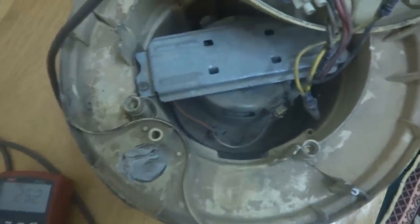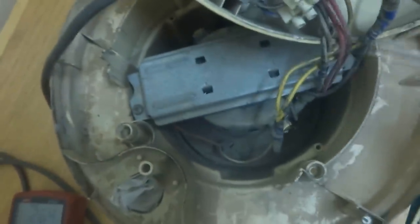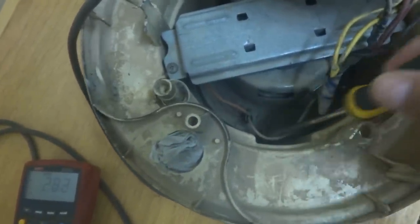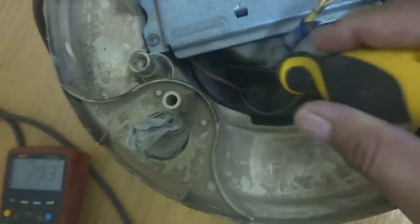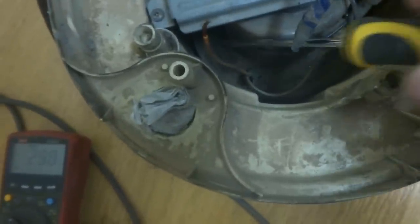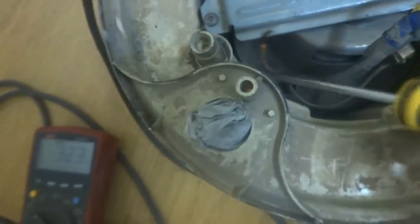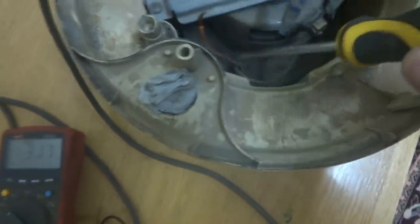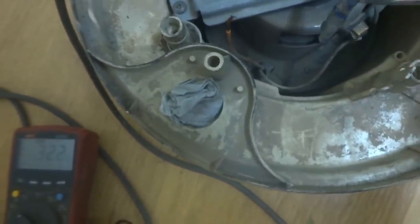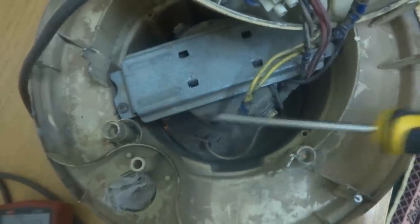Here I am going to see this cable - you can see this cable is coming from the power cord to here and then going back towards the unit inside. This is a two-core cable - one is connected over here, the white one to the brush, and the other cable - I just found it - as you can see, this is not connected anywhere. This is not normally the case. This is going to the motor - it should be connected somewhere, going to the field of the motor which is located over here. From my experience this should be connected to this one.